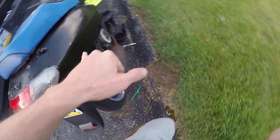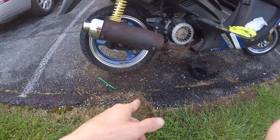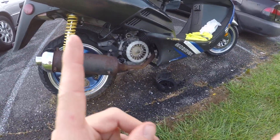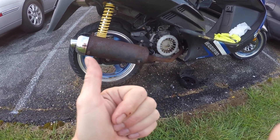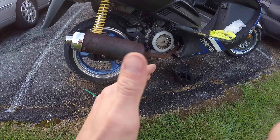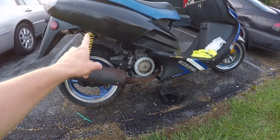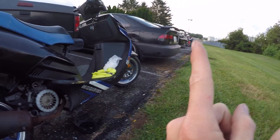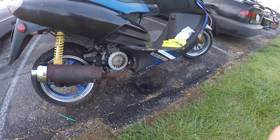So currently what I've got going on with it right now — I have the cover off. I cleaned it off even though it rained earlier and now there's like a puddle of dirt. I'm double-checking valve clearance on this before I do anything else because I haven't changed the oil yet. I've driven it about a hundred to a hundred and fifty miles now with the current setup. This is a DC setup by the way — this harness is DC versus the red one's AC harness, which I really wish I would have been able to get going, but I tried transferring over the AC harness into this and it didn't work too good.